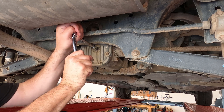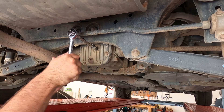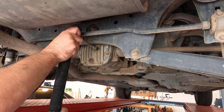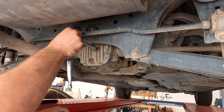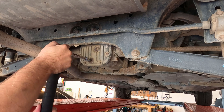You always want to make sure you can put fluid back in before you drain the old stuff out. So we'll start with that top fill plug — just push the socket in carefully. You don't want to strip this, so be very careful. I might use a breaker bar for leverage, but go slowly. That wasn't too bad, so it'll come out just fine.